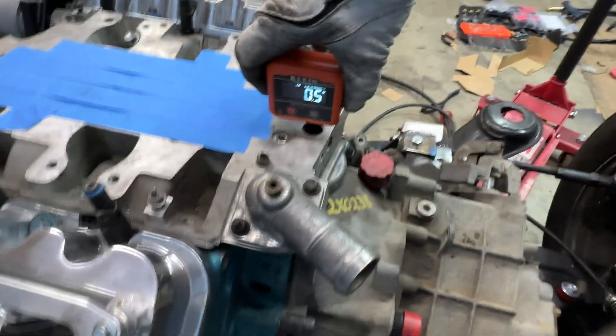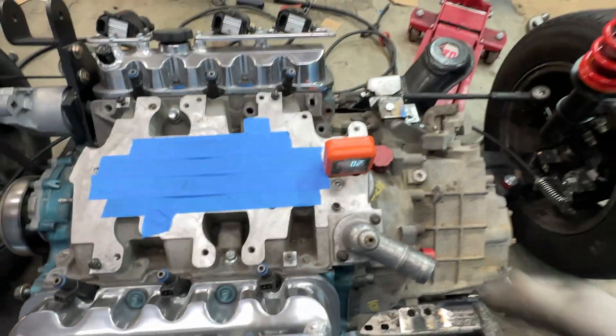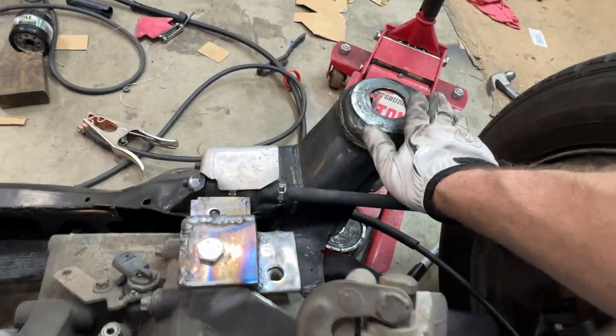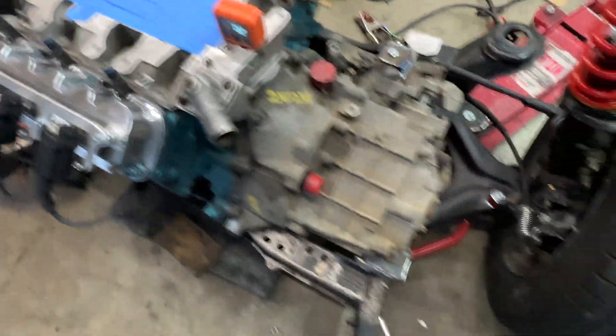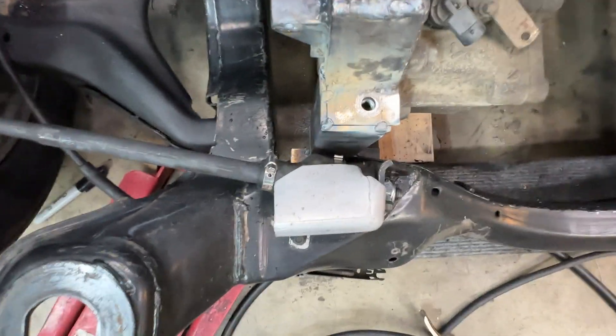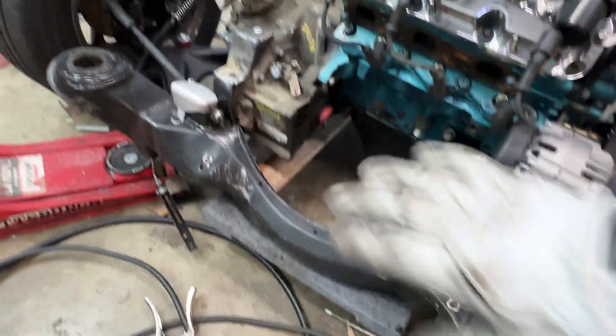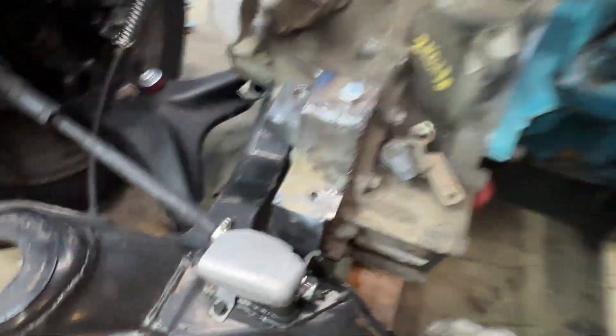This side is a little wonkier — I'm definitely going to need to brace it, so I'll be adding gussets anywhere I can to strengthen it. We've got two bolts holding it down. I'm thinking about adding another bolt. With the front mount and the two holes this should be fine. The motor is within one-tenth of a degree. The angle of the nose of the crank to the transmission is a little more off than I'd like, but it's still under half a degree.